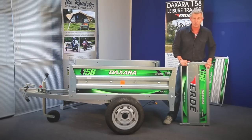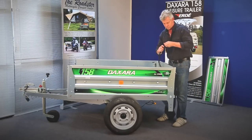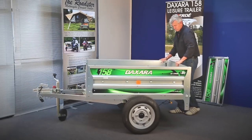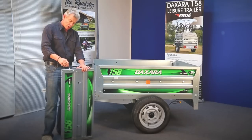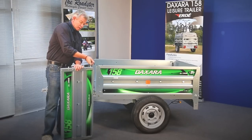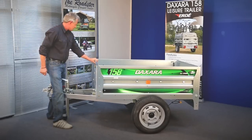We've got the panels nicely done up tight — time to insert the doors, firstly with the rear door. With the front door it's a little bit different to the back one in the way it fits. The first thing you have to do is just adjust these little bolts with the Allen key, open those up a little bit, and they might require a little bit of adjustment as you slip it in. That should all be square, and if it is it will just plop into place.